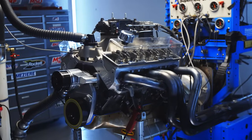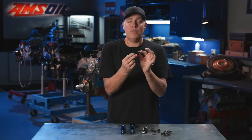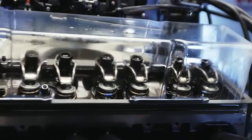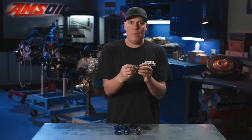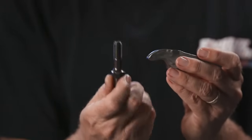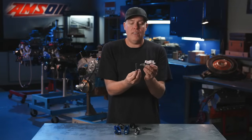Number five is weight or inertia. If the pivoting part of the rocker arm is really heavy, that's part of what the valve spring needs to control, and it can lead to valve float, costing power. Number six is reliability — a big deal with rocker arms, because if one fails, you've got a dead cylinder. The first rocker arm we tested looks like a bone-stock Chevy stamp steel rocker but has significant upgrades from Howard's Cams: it uses the larger-than-stock 7/16 inch stud for more valve train stability, and it's been modified with a longer slot so the stud doesn't limit the rocker arm's travel.